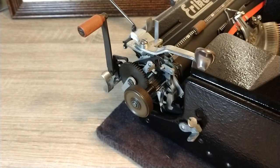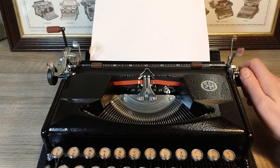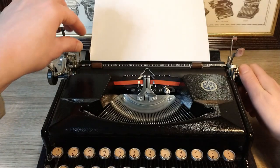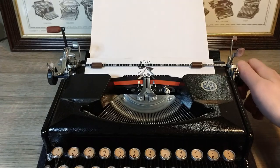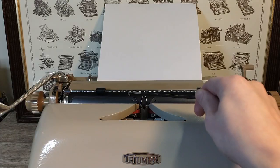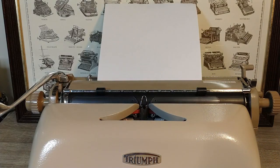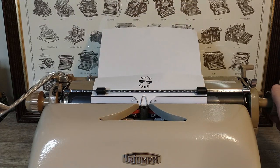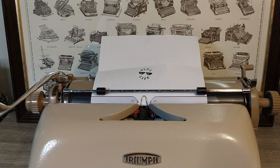You can't set the number of lines the paper advances like on a standard, but this mechanism has another trick up its sleeve. On most machines, you need to lift the paper bale to make sure you can feed the paper properly. Some machines solve this issue by providing transparent plastic card guides that keep the paper in contact with the platen, up to the paper bale rollers, so you don't need to lift the paper bale.